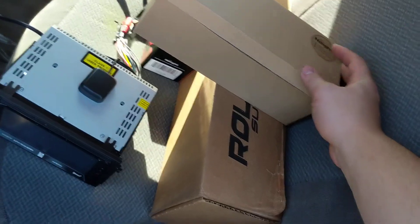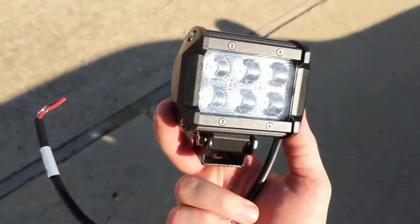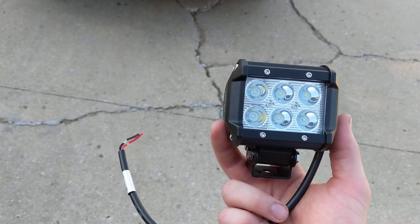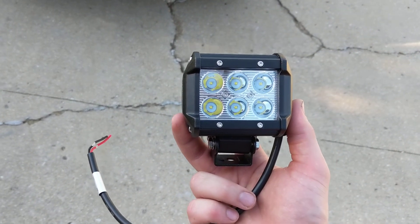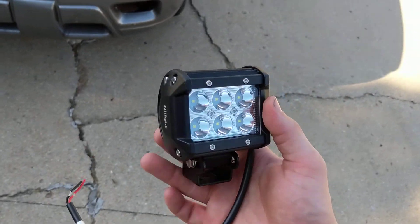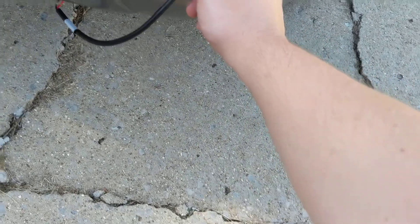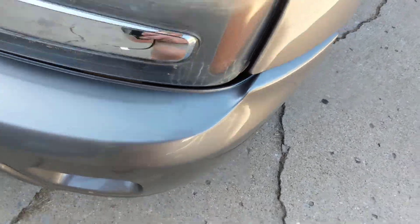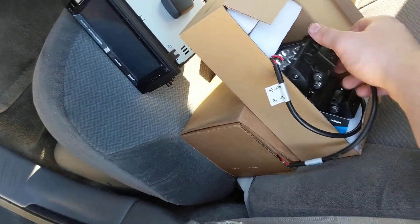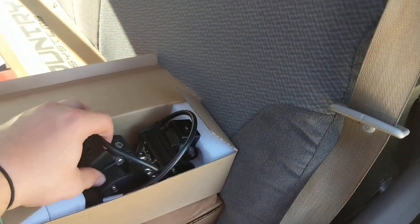Right here you'll see the lights I plan on mounting to the underside where the fog lights would be. These are Nilight 4x4 spot lights. I ended up going with spotlights over floodlights because I'm planning on using these as fog and driving lights, and I wanted them to reach out past where my factory brights would go. These will pop into the piece of metal that crosses right down there and sit right in place. I picked them up for about $20 on Amazon — they've got really good reviews for the price, and I don't need them to light up an entire cornfield, so hopefully they'll work for my purposes.